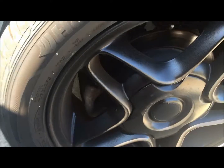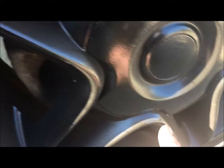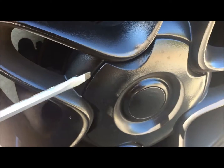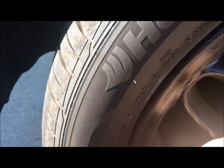In order to get to them, the hubcaps usually have some sort of groove on one of these pieces. What you're going to do is get a screwdriver underneath there and pry up on it, and then they just kind of pop off, just like that.